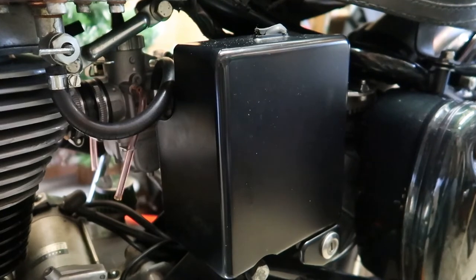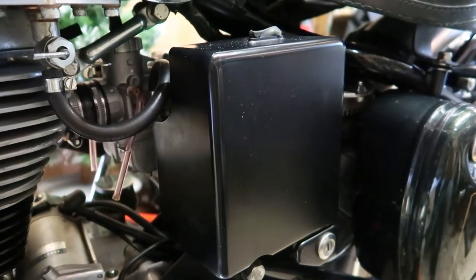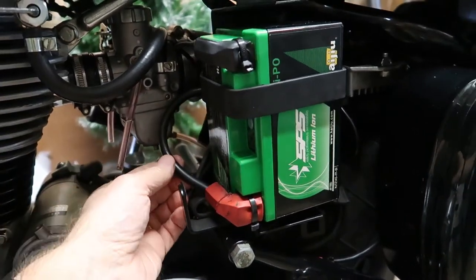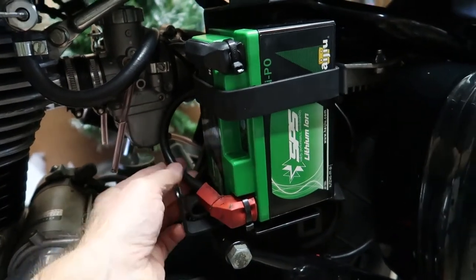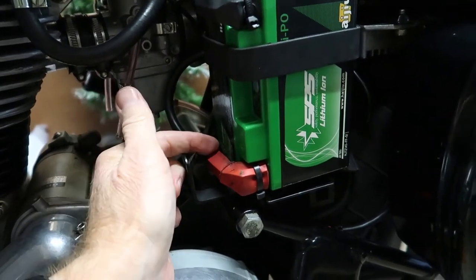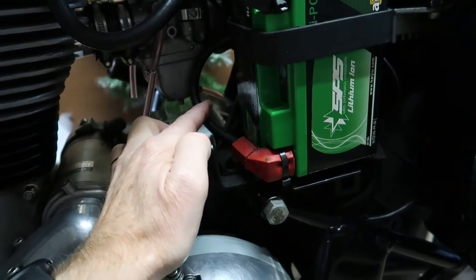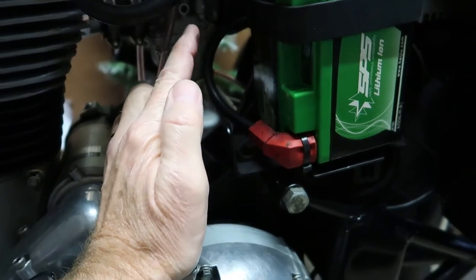The ammeter would normally wire in between the positive cable and the positive terminal on the battery. I can't do this on this bike — let me just remove the battery cover and show you why. The positive terminal there is only one single cable. Normally you get two cables: a thick one which goes to the main starter, and a thin one which goes off to the rest of the electrical power system. This one is different — it's not because it's got a different battery fitted, it's just the way this bike is wired. This main lead goes down to the starter relay, and then you have a secondary wire coming off from there which goes to the power.